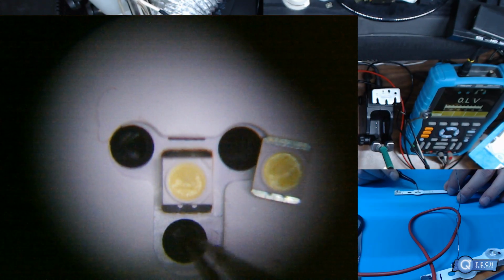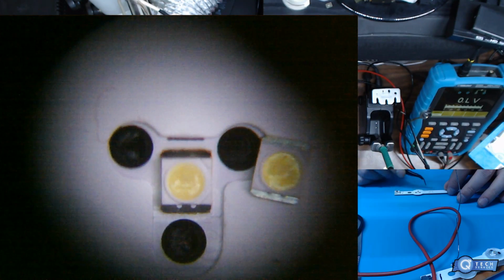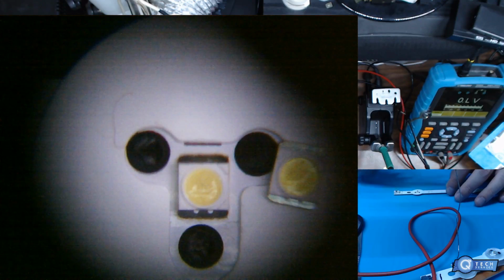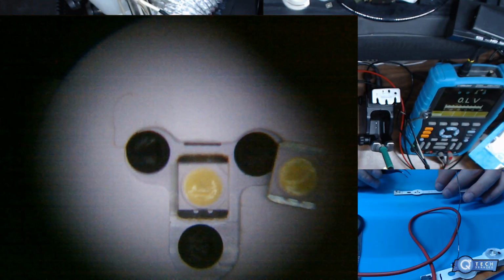What you're going to want to not do is, when you're removing these right here, let me zoom out here. When you snap these plastic shields off, you want to make sure you have them the right direction and in the right order, putting them back. And then you're going to put a little glue on each little spot, very lightly. That way you're not getting no reflections or anything like that. You get a brighter picture than some displays where you'll have more of a white spot in the screen itself. So just figured I'd throw that out there, trying to give people advice.